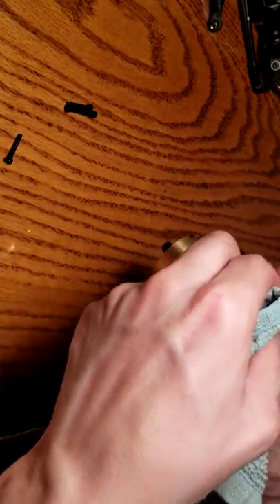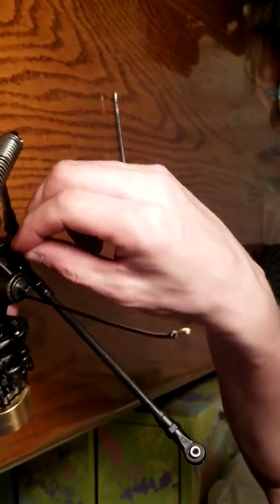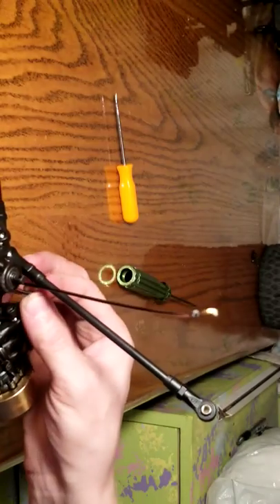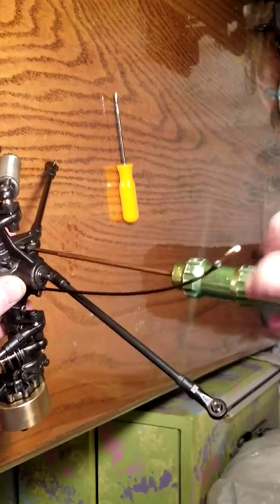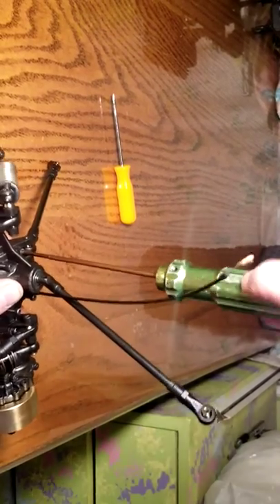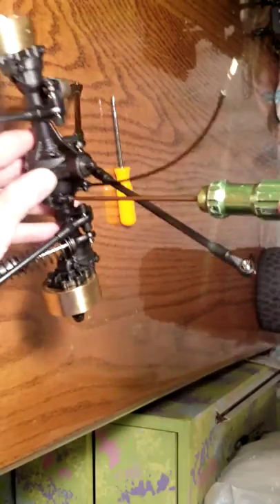If your diff is running dry, or if you're one of those people who drives their rig in mud — which I think is a bad decision — you'll probably have rust on your bearings, in your portal gears, on your ring and pinion. You're probably gonna be filled with rust if you do that and don't properly maintain it immediately after you're done running your vehicle.